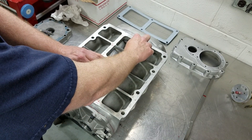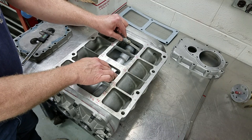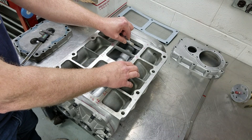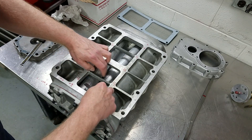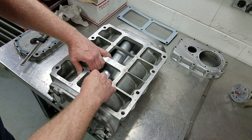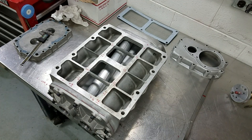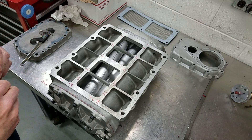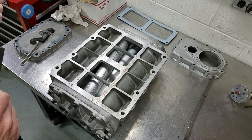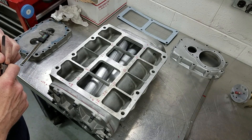Surprisingly, everything is pretty even. I come up with about 11 thousandths clearance between each lobe of each rotor at the front corner and at the back corner of the case. This means that I will have to push the rotors down in the case by about 4 or 5 thousandths of an inch. Even though the SA Designs book and the Detroit Diesel Manual both say the bottom clearance can be as tight as 4 thousandths, I'm going to go slightly bigger — I'll probably shoot for around 5 or 6.